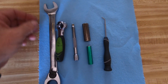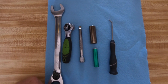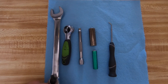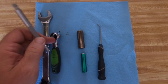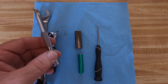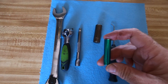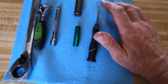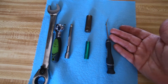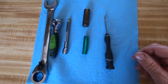The tools you're going to need for this oil change: a 19 millimeter wrench, or if you want to be a caveman, an adjustable crescent wrench. You can use a quarter inch drive ratchet — this is what I like because it's smaller — plus an extension, though you can probably get away without the extension. You want a 12 millimeter socket and an 8 millimeter socket; they don't have to be deep sockets. A pick tool is also handy to get the filter out. You'll also need an oil pan, a funnel, rubber gloves, and safety glasses.